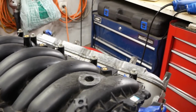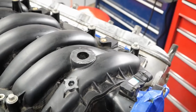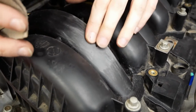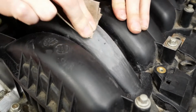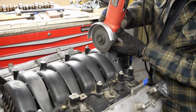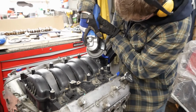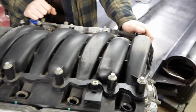What's left is a small hole that goes down into the intake, and generally holes in your engine are not a good thing. Our plan is to come back later to smooth out all these channels and seal up the hole with some kind of filler. These manifolds are made of nylon 6/6, which is plastic weldable, but difficult to fill or bond with other materials. Our current thought is to use an epoxy putty such as Milliput to fill in the voids, but we would welcome other suggestions if you've worked with nylon and have a better solution. In the meantime though, it's helped clean up the look and reduce the size, so let's press on.